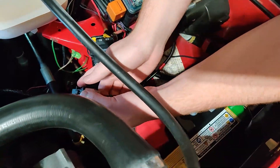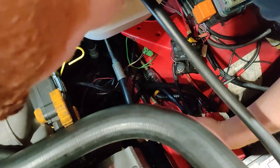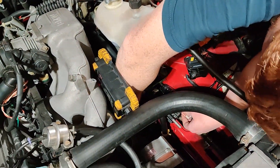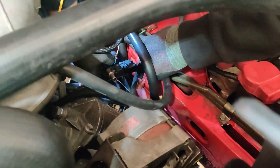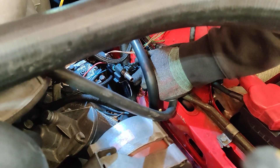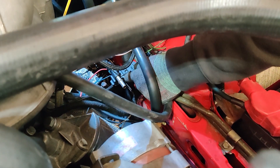Lastly, apply a little bit of oil to the steel fittings so that when you click into the Bundy fittings you don't damage the O-rings. The quick disconnect fittings that go onto the steel part of this sensor have O-rings down inside, and it is best practice to not push dry metal against the O-rings if you want them to last. So as a safety precaution, always put just a touch of lubrication on those before clicking them in. Once you get these fittings crimped on, it's simply pushing the Bundy fittings on — and once you hear them click, they're completely sealed and ready to go. Unless you have a manufactured defect, you won't have any issues once they clip in.